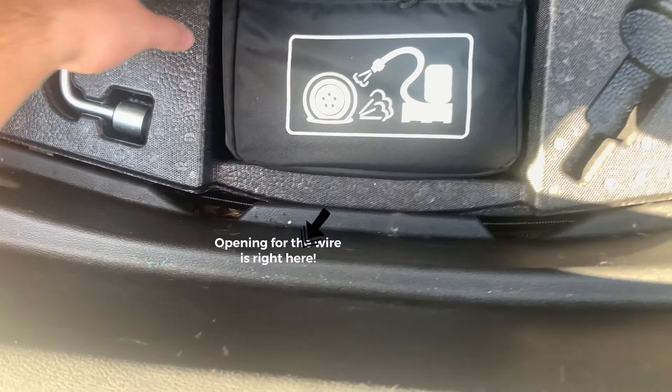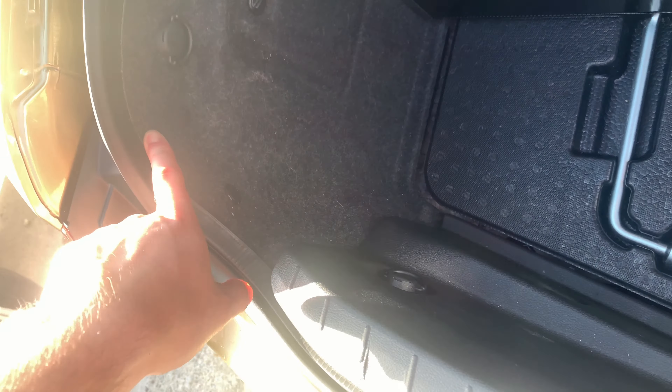Hook it into the brake light. First up, you need to remove the carpet liner — take that out completely. Then the tray where you have your fixed flap — pull that out as well so you can undo this panel. Then you have to undo these clips on the left-hand side, and from here you can pull that back and you'll have access to the tail light, and then you'll be able to do the wiring from there.